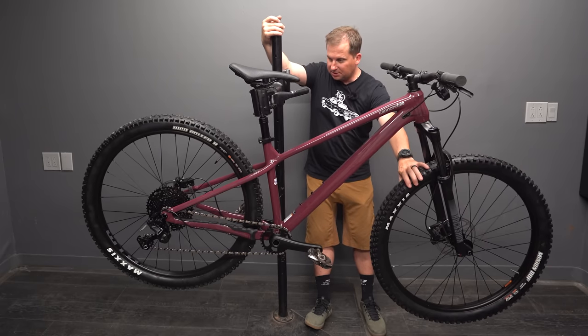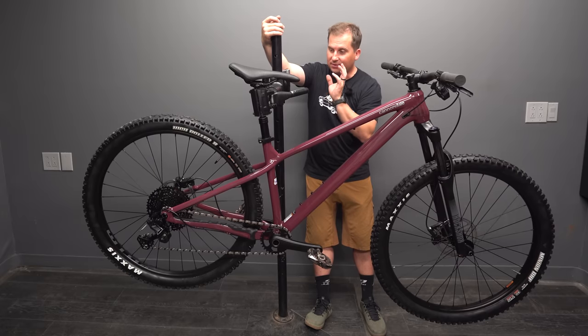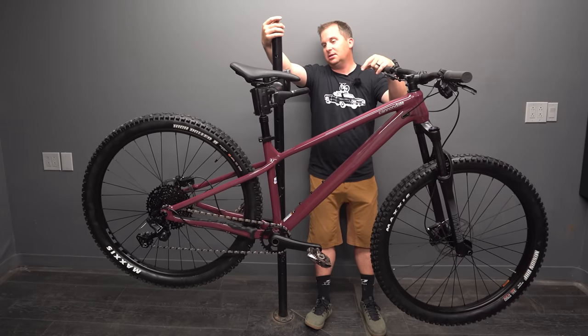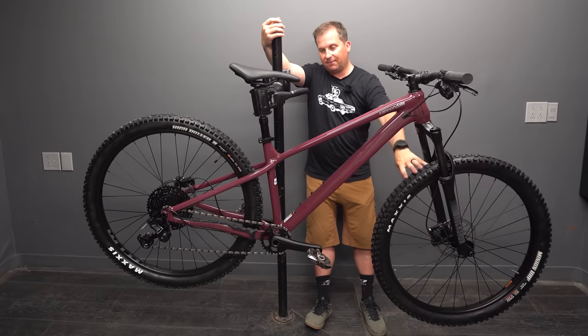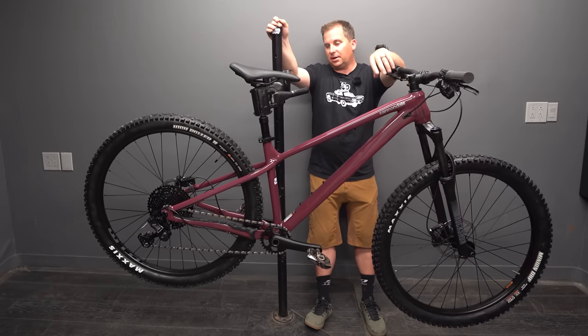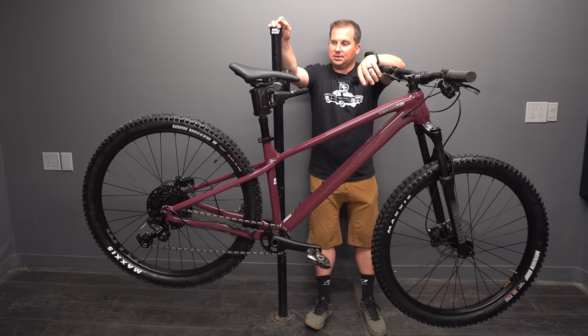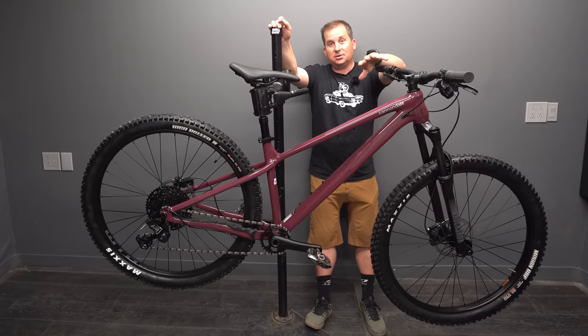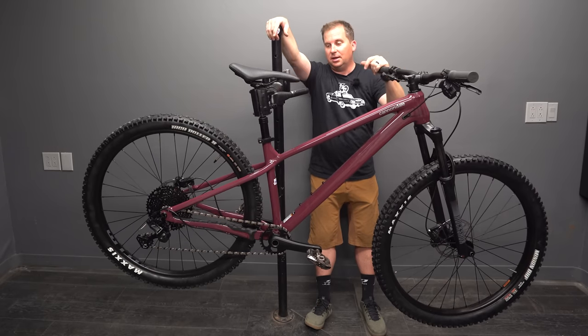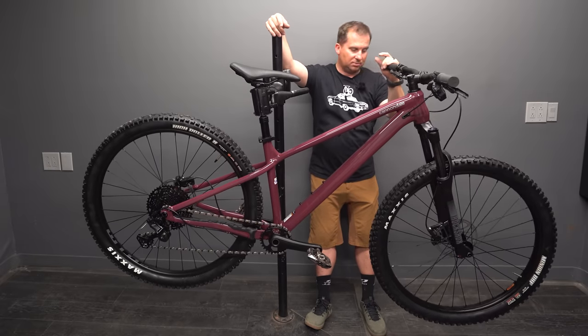We have a dual compound DHF front, and we have a 3C High Roller 2 in the rear. Usually I see the 3C stickier compound in the front and then the more durable in the rear, because the rears usually run out first. But I'm guessing this is a game of, hey, is there a tire in stock? Great, put it on our bikes and we're shipping it out. A lot of bike companies are still encountering stock issues when building these up.